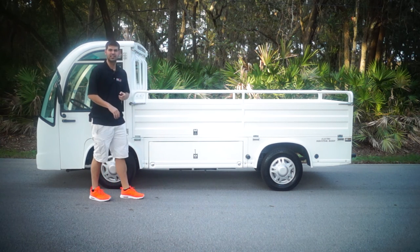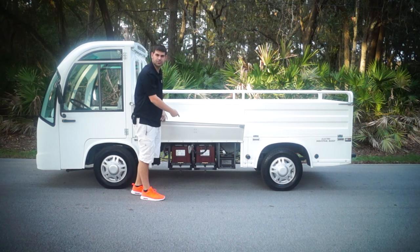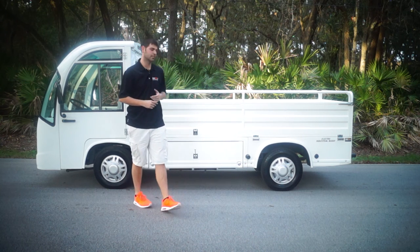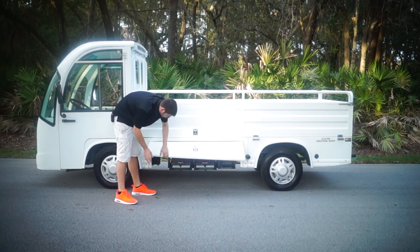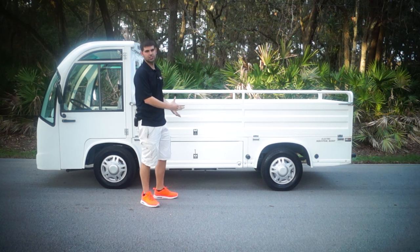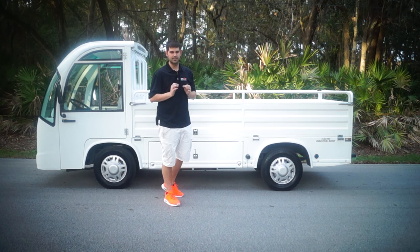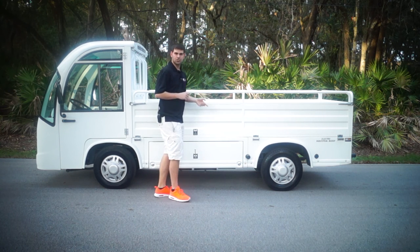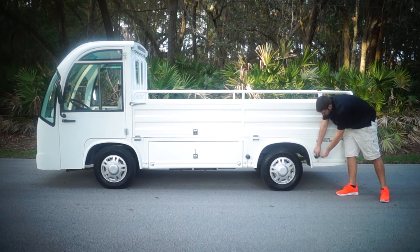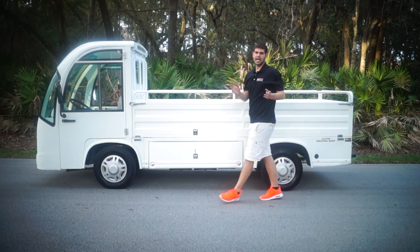I did want to hit on two features I think are extremely important. One: our batteries. All of our batteries are located underneath here along with our onboard charger. You plug this right into a 110 volt outlet — you don't have to worry about setting up a specific charging station, which is really nice. We made this lockable so you can't access your batteries, which is one of the most expensive things on your cart, and a lot of you guys will be leaving this outside. All your Trojan T105 batteries are the standard batteries located underneath, and they come with an 18-month warranty, the longest in the nation. Trojan is a fantastic battery. The onboard charger is right here on the cart — you pull out the charging cord and plug it into an extension cord, so you can plug it in anywhere on campus.